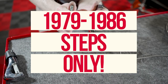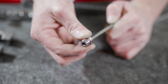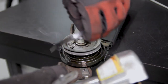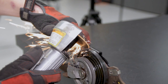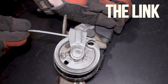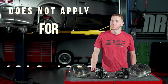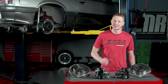Because of the hardline differences on the early Fox Mustangs, you will have to cut and flare the factory hardline using a brake flaring tool. If you own an 87-93 car, you will have to modify the parking brake cable assembly so that the self-adjusting feature is omitted. This is done by removing the clock spring and welding the pawl on the handle to the second-to-last tooth on the gear drive. Check out the video in the description to see how this is done. 79-86 owners don't have to worry about this, as the parking brake assembly in those cars did not have a self-adjusting feature.